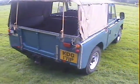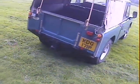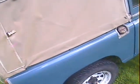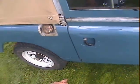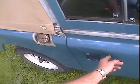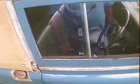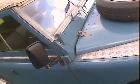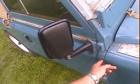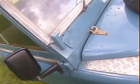Looking down the offside, again, looks pretty straight, really. There's no sort of giant ripples or anything, by Landy standards. A couple of chips back there on the offside rear wing. There's a large chip in the bottom of the driver's door there, and there is a slight dink just there in the barrel side on the driver's door, and a couple of bits of paint loss on the door top. Bit of paint loss there where obviously the driver's door has hit the A-post at some point.